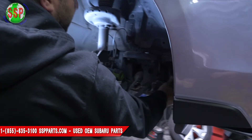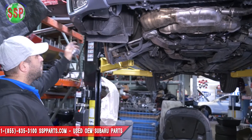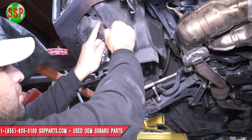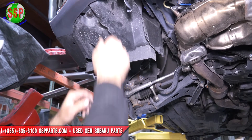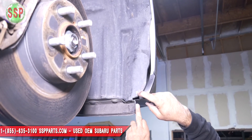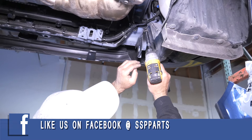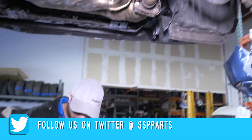It's all in. The only thing left is the bottom, so we're going to go up. I want to show you guys where these land. So we got the fender liner in on that side. This thing needs to sneak up in here — this lip right here goes inside, right above that. This right here needs to meet with each other. Right here is a hole — there's a clip spot on the bumper. If you bring it together, this should all sit. There you go. These guys right here are for this guy right here — I'm going to put that on next.